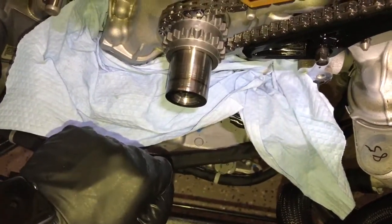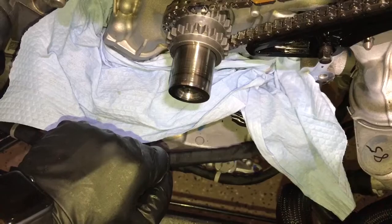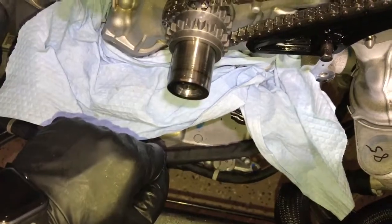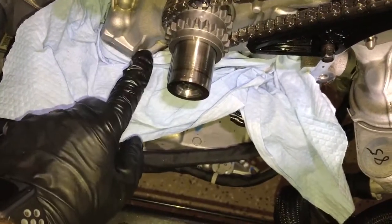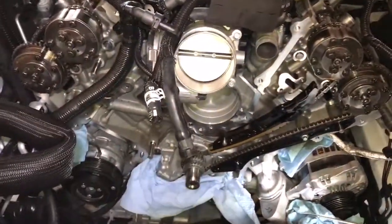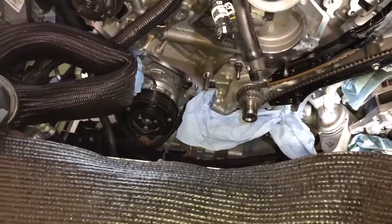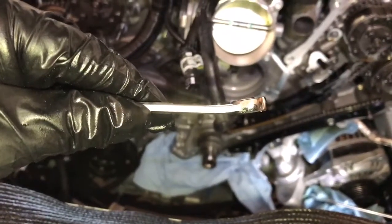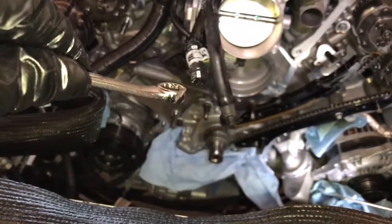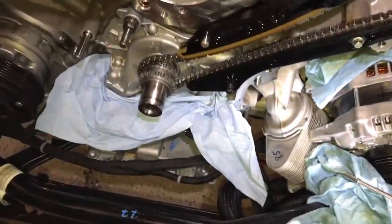Made sure all the pieces were intact — that was my safety strap in case it fell, and it fell a bunch of times. The tape is awesome. I tried a string around it to spin it but I couldn't get enough grip — too much oil. Once you get it there, get your combo wrench. A small one with just enough of an angle — I've had this Craftsman set since I was probably 19. The 10 mil has just enough angle where you can get in there and get enough to work on it.